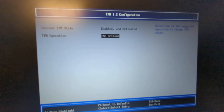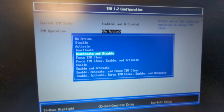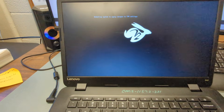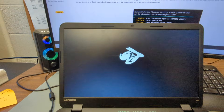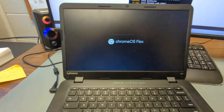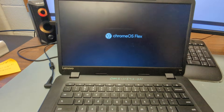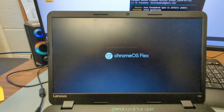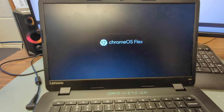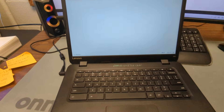Once you do that, push Escape to exit and reboot. It's going to reboot and apply the changes to the TPM. This time you don't have to push Escape or go back into the BIOS — it'll just boot normally into Chrome OS Flex and you're done. It should now be on the newest or second-to-newest version of Chrome OS, and you'll be able to update it to the newest version anytime. It'll never be end of life now. Hope this helped — if you have any questions let me know in the comments and I'll try to help you out.